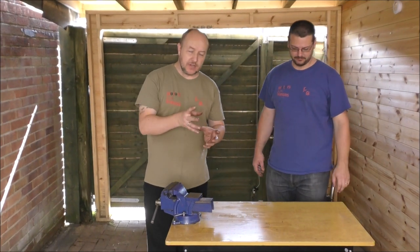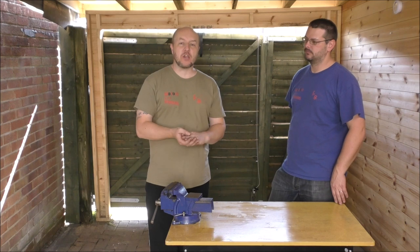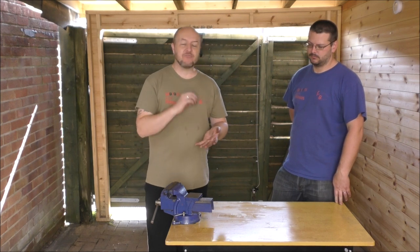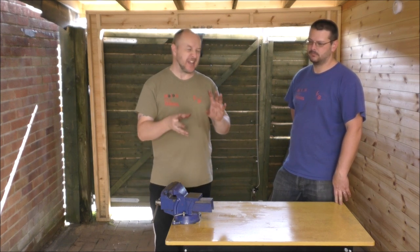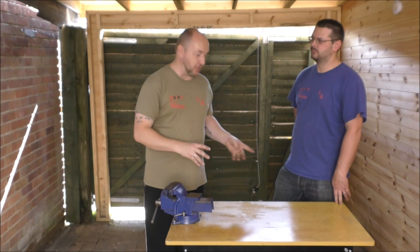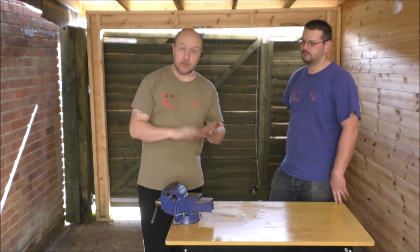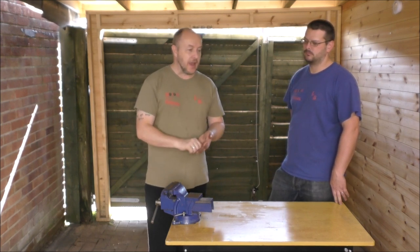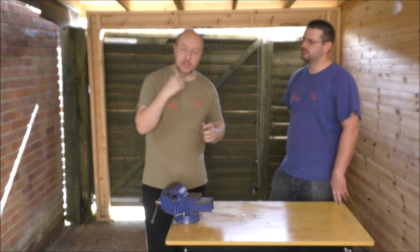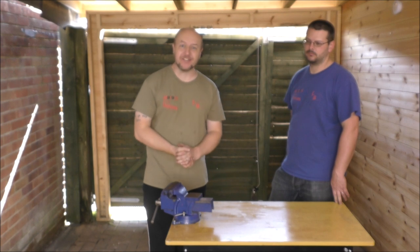We can't put the gaiters on yet because in the next episode of the Motors for the Masses bike build video, we are going to repaint the forks, repaint the engine, and repaint the wheels, and they're going to be a satiny black. So, in preparation for that, we need to get an engine bolt dress-up kit, so basically a complete kit of stainless steel bolts, and black barbecue paint, because that's what we're going to use, since it's very high temperature, and an engine degreaser, and some stainless steel clips for the exhaust wrap. Because in the video after that, we are going to be rebuilding.